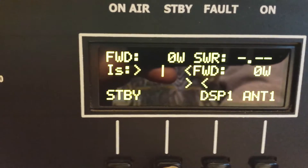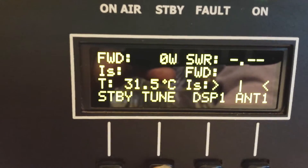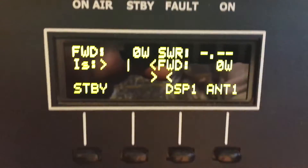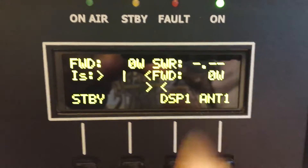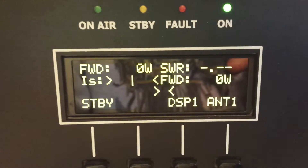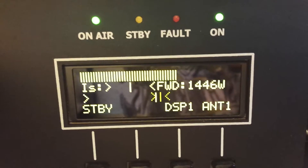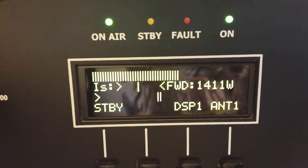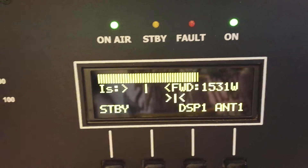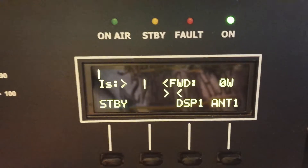There's a stoplight flashing — if you wanted to go back to your normal screen, that's what you would do. But you'll see as we apply power here, this top row will change. I'm going to go ahead and apply power and show you just how easy it is to tune this amp. As you can see it's pretty close to tuned right now. We'll just hit it a little bit and that's all there is to it. The amp is tuned at this point.